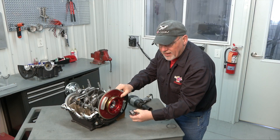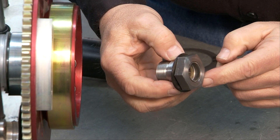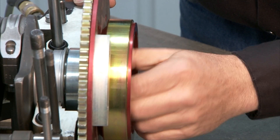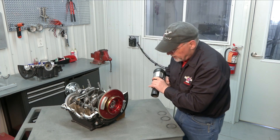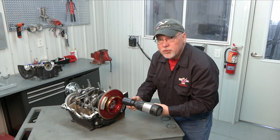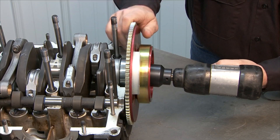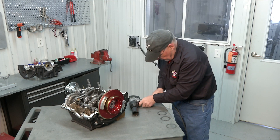This is the flywheel gland nut. It has a wavy washer on it. This is the nut where you have to use the 36 millimeter socket that I talked about in the tools segment. We'll thread it in by hand as far as we can, then use an impact wrench to install it. We're not going to measure the torque this time because this is just a temporary installation — we just want to make sure the crankshaft and flywheel are together tightly and properly aligned so that we can measure our end play.